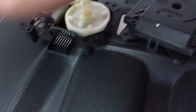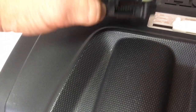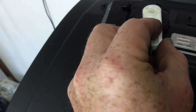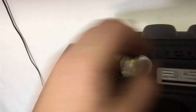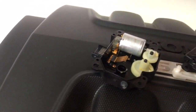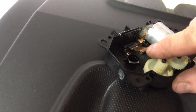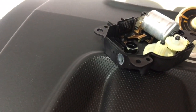When you take it out — I'll show you from the actual sensor — all you have to do is remove that piece right here and open this up. Be careful not to break the small plastic tabs. Here is where the problem is: there's nothing actually wrong with the sensor itself. The problem was that these little pins right here had grease all over them — they were basically packed up with it.